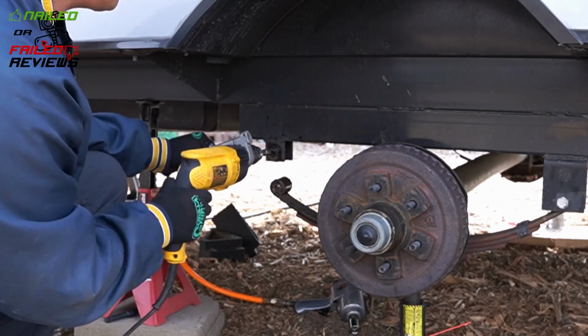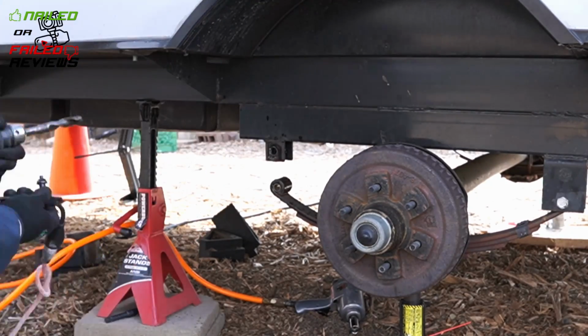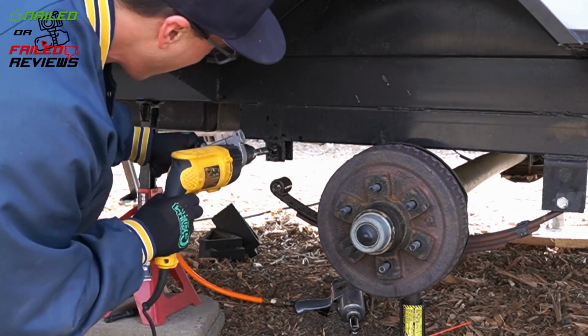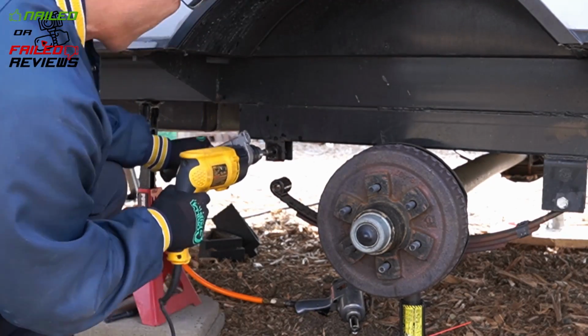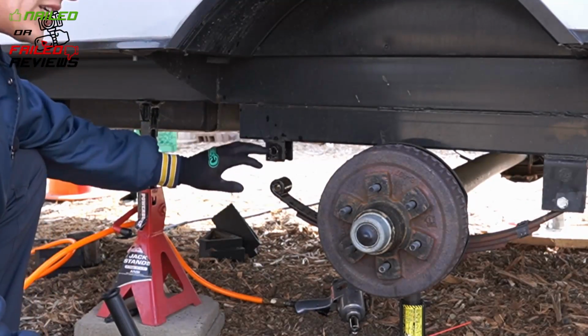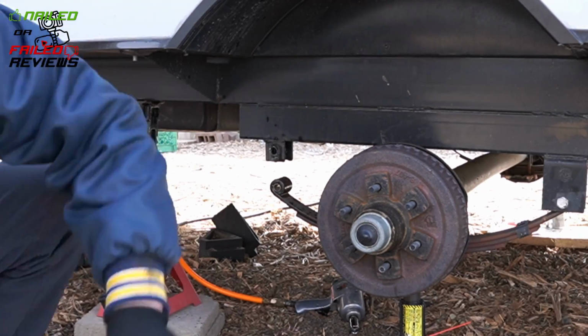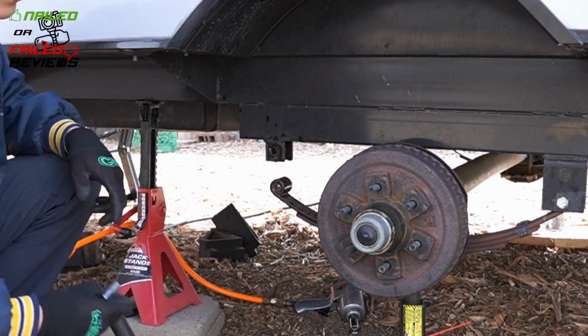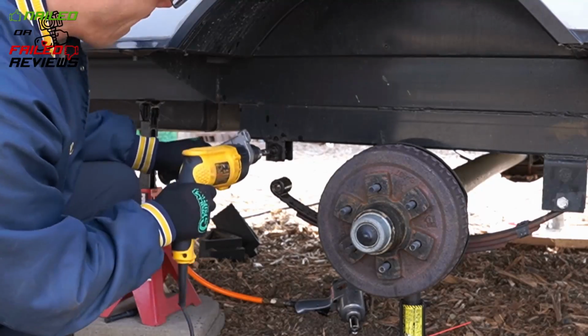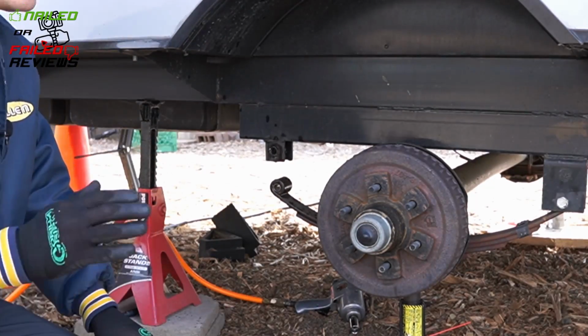Now again, you have to remember that you have to accommodate the outside diameter of the wet bolt. So wet bolt is 9/16. You have to have it a little bit bigger so that there's a little wiggle room, just a tenth. And so you have to accommodate that and then figure out what size outside diameter your drill bits can drill, and then have a bushing made to accommodate that. So it's not going to be the same size for everybody.